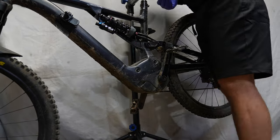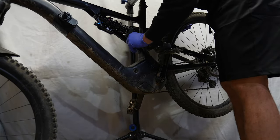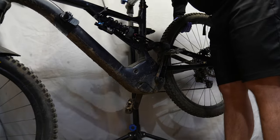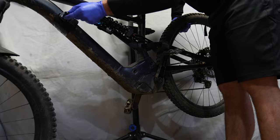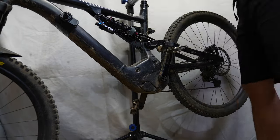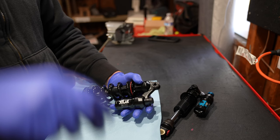My experience on the DHX wasn't particularly good, but let me know in the comments if you like it or you don't. Keep in mind this is a 57 pound e-bike that does better with DH stuff. I suspect the lack of high speed compression adjustment or bottom out control on the DHX is the real shortcoming. So why is the DHX so unpopular? I don't know — but both these shocks were around $300 on Facebook Marketplace as takeoffs.